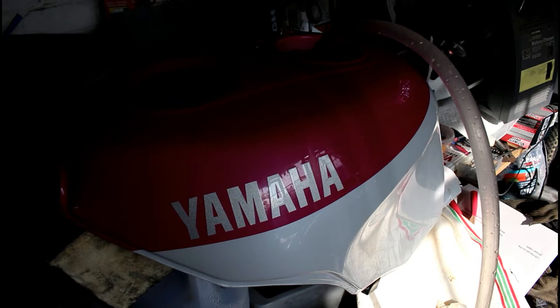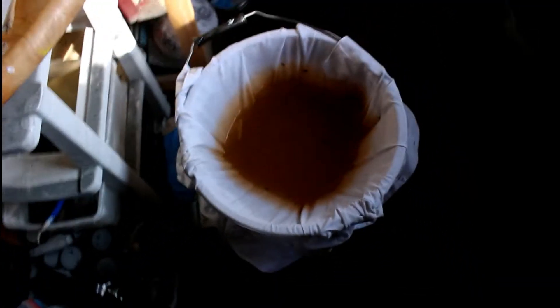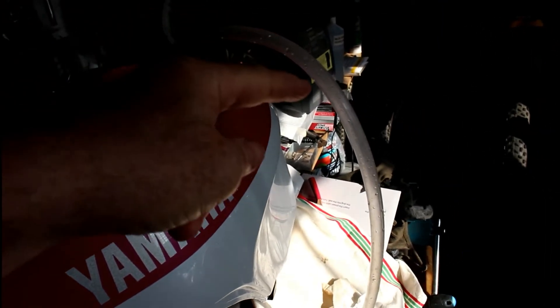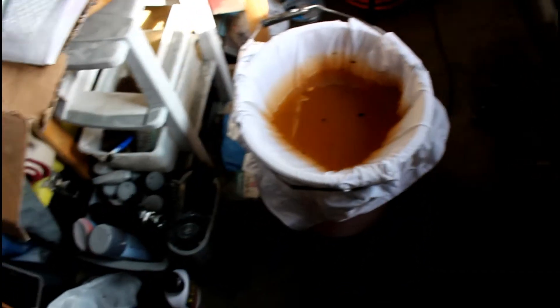This is the next morning after the first evening of electrolysis. So this is the state of the anode — as you can see, that's a lot of rust that's been attracted to it, because that's where the electrical charge is being run through, so it pulls all the rust through the solution. In case you're wondering how I got 19 litres of fluid from there to there — I just used a good old-fashioned siphon. I don't necessarily suggest people should do it, but suck on the pipe as the fluid comes up over the bend, then stop sucking and it will pull all of the fluid through the pipe. It took me a couple of times and then it did.